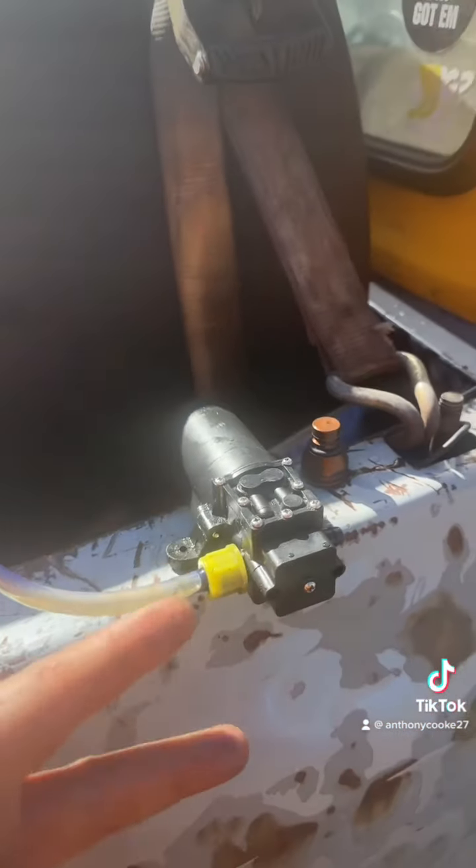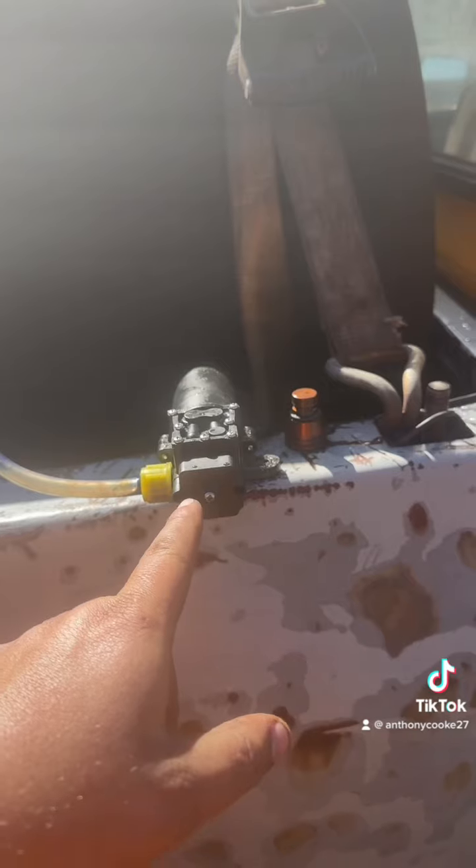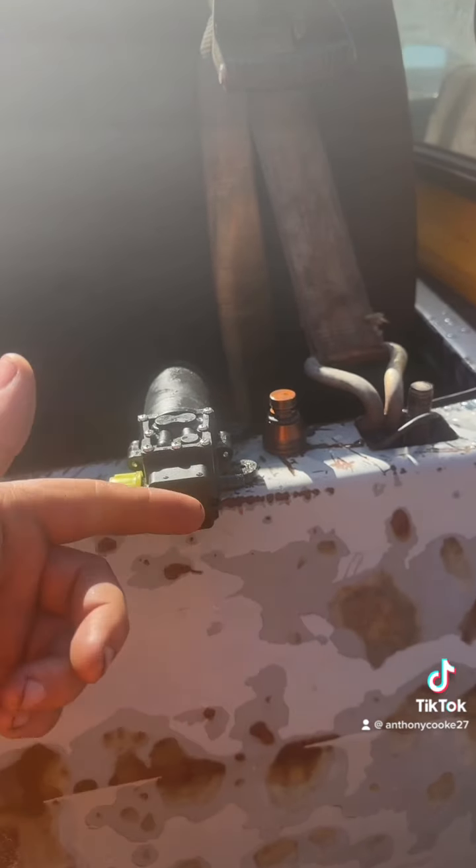Some of the things I've learned on this trip: the electric fuel pump I was using had two problems. One, it was not pumping enough volume to keep up with the injection pump. The second thing — this regulator that you adjust the screw on for how much pressure it puts out — either clogged up or something mechanically happened inside and over-pressurized the fuel system.